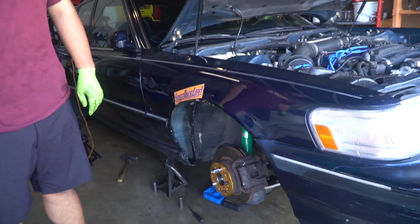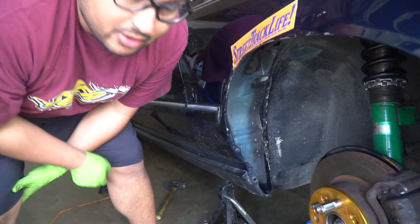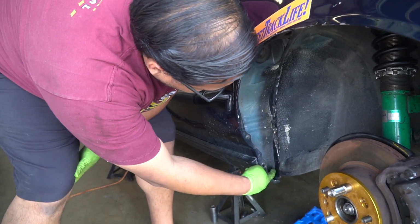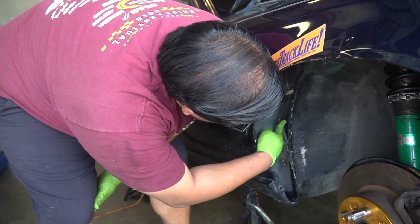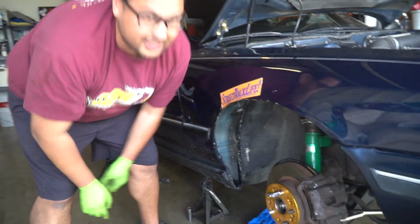Alright, so we're done with the tension rods, and it pulled the hub forward a lot, so hopefully that helps us. Now to clear the firewall, we're gonna hit all these parts where it's rubbing with the air hammer. So what I'm gonna do first is make some slots in here just to make it easier to hammer down. And then we're gonna have some fun. So that's next.